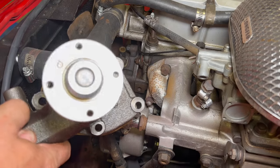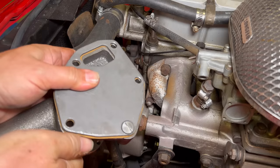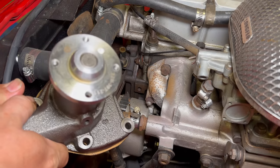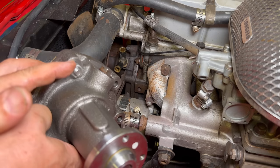If we take a look at the new water pump, there are four bolts that we need to take out. This bolt up here actually holds the water pump together, so that fifth bolt you don't take out to remove the water pump — and that's important. It's actually only four bolts that you need to remove in order to get this off. Don't take this one off.